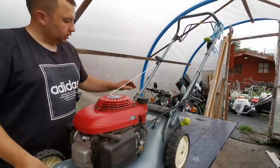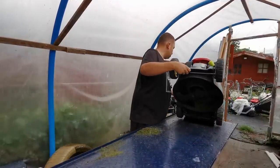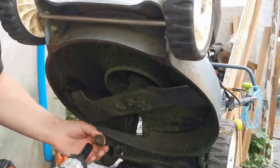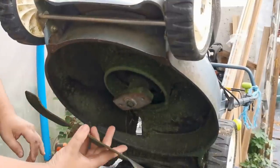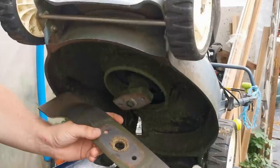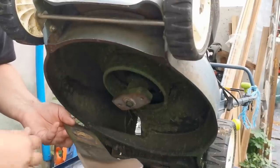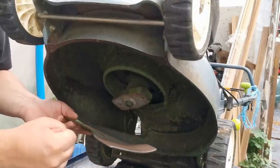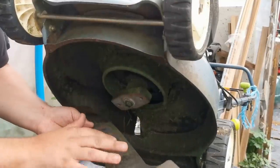We've got the HT lead still off. We're going to lay the mower back. Right, so you can see it's really clean under this deck. So it's a 14mm — I've got the old impact gun. That's one there and there's two. So always just remember which way your blade came off — it has fins on it, and they want to be facing up in the deck. So I'm just going to take this in the log cabin now and just put a nice little edge on this. I won't show you that because people sharpen their blades in their own way. There are various ways: you can do it on a flappy disc, on a grinder, a belt sander. They even do little stones for your handheld drill that you can just run along it. So I'm just going to go in the log cabin, sharpen this up, and I'll come back out.